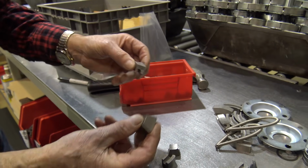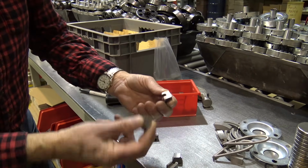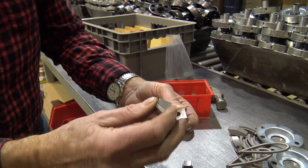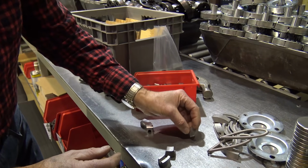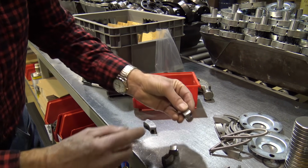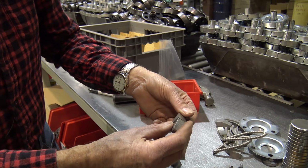After I cut them, I'll take them on a belt sander and just kiss them lightly to take off the little snap where it breaks through. And I also just turn and rotate it 4 times on the belt sander to put a slight radius so I don't have a sharp edge going out to the drum.